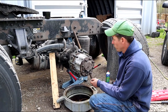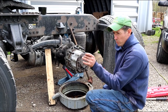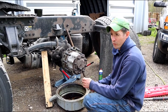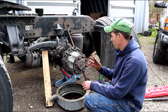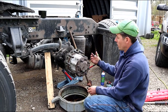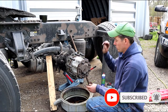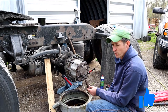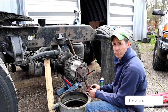That's pretty much it for changing a wheel seal on the rear — it's basically the same on the front. I did my driver's side hub back in February but the video didn't come out well; I'll do the other side shortly. If you're changing bearings, it's kind of the same process. You can also buy the preset assemblies with seal and bearings already installed — those are a slightly different setup. Then we put the brake shoes back on and we're done. Thanks for watching.